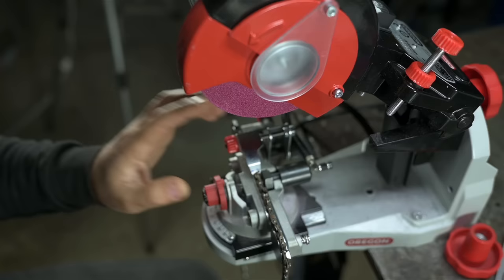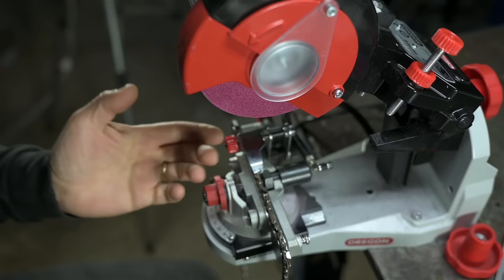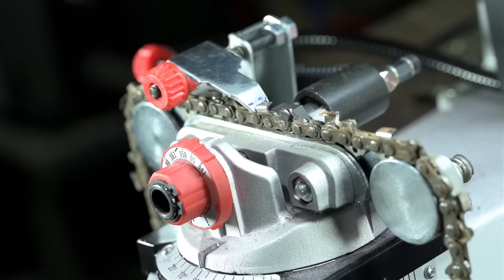There's one more modification I would have liked to try and share with you today, but I haven't figured it out yet. From what I'm seeing so far, poor form or setup aside, the biggest source of error, variation might be a better word, a better Scrabble score if nothing else, is coming from this vise. I don't know if it's just my impression seeing everything move so much, but this whole setup doesn't seem exceedingly repeatable.